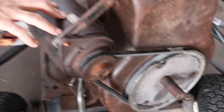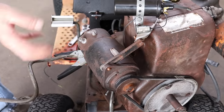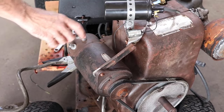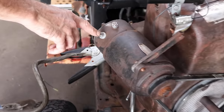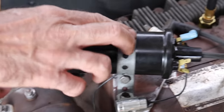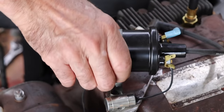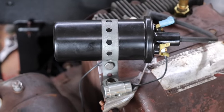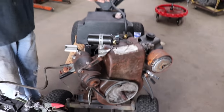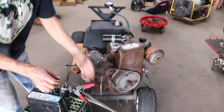I took the starter generator apart, just went through it, everything looked good, cleaned it, sandblasted these studs to get all that rust off of there. Elk Skins thinks he might have a coil mount. He's gonna look. And so now the fuel pump works, everything works. So I'm gonna crank it over and show you how much more compression it's got since I did that valve job.